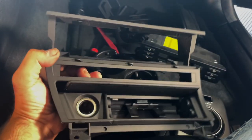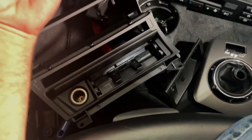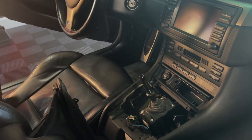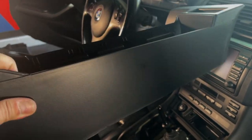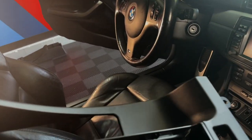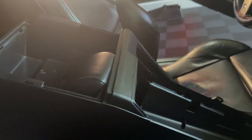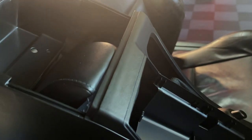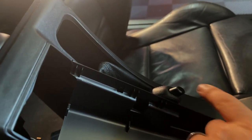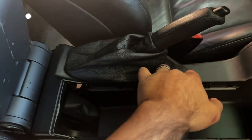Now with the cigarette lighter back in, we're going to put everything back. The climate control — we're going to put it back in. We're going to put this piece back in first. So with that back in, now we're going to put in our new center console. Let's start feeding it through here — first the armrest. Make sure that's up so we can slide this in first, and then we're going to get the emergency brake through. I have the lip touching the very top just so I can get the emergency brake in too, and then we can slide it in. Feed your boot through it and then snap it back into place on both ends.